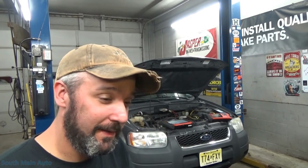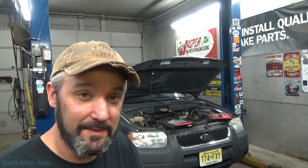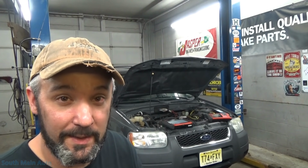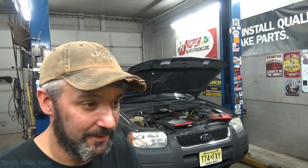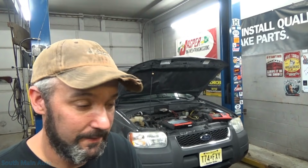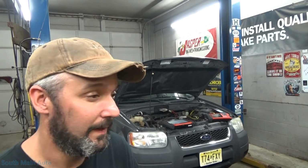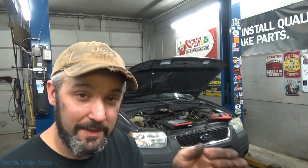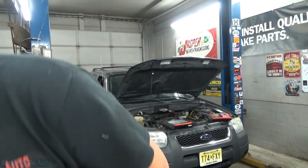So I'm thinking, is the noise being put out by the ECM, or is it being received back through that wire? Is that wire acting like an antenna? Is it picking up secondary ignition? Is there something going on there? Unplugged all the coils on the back of the engine, nothing. Unplugged all the coils on the front of the engine, nothing. It still has this crappy signal at 3000 RPMs. And I'm going to show you guys what I did.